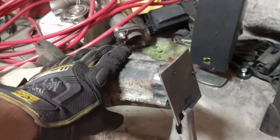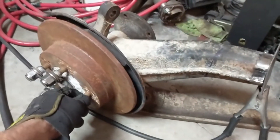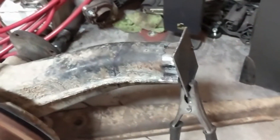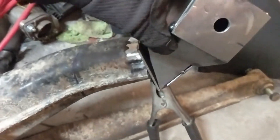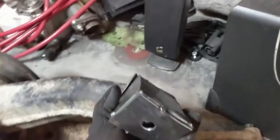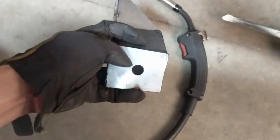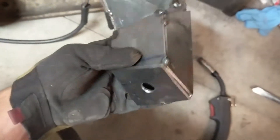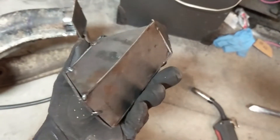Since I'm not going to film the entire process because it adds too much time and I'm getting time-crunched — well, it's way past October — but this is the rear trailing arm. A lot of you saw the mock-up on Instagram. In order to weld it to this piece I need to first weld a plate that allows me to weld onto it. There are some pretty bad gaps but that's the plan, which is going to allow me to get this trailing arm working. I won't weld this faceplate on yet because I'm going to weld a quarter-inch plate on the back and then a nut on the back of that, so this actually has something to screw into. That'll decrease the strength if I cut a hole in there, so I'm trying to keep as much strength as I can.